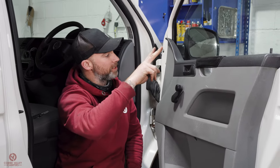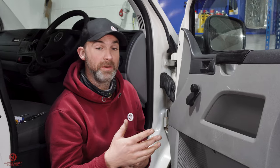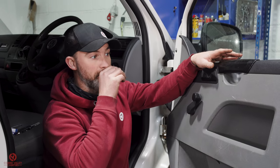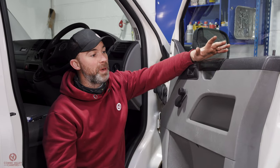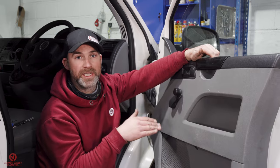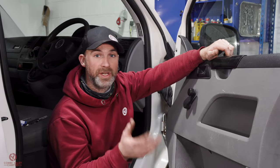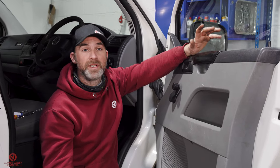To recap: we greased the window winder channels, investigated the central locking lock — turns out I didn't need the new part, it was mostly the dirty body control module not giving a signal. We thought there was a broken wire, turns out there wasn't, because when I locked the door with the key it all worked. Although we did this video in two parts, we actually achieved quite a lot. A huge thanks for watching and being patient with the mess-ups — it's all part of owning one of these old Volkswagens. You've got to investigate why something's not working, and with a budget car, getting your hands dirty will keep the price down. We paid two grand for this and spent minimal on it so far, and now we've got a good serviceable vehicle I'm actually using daily — taking my kids to school in it, the dog, putting miles on it.